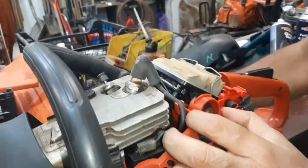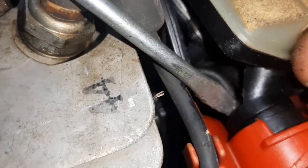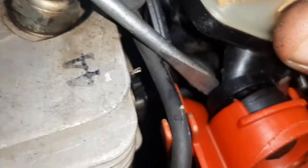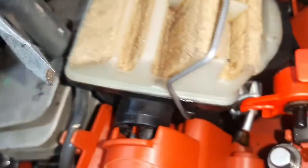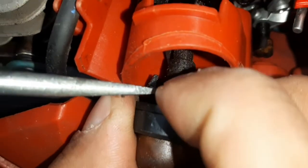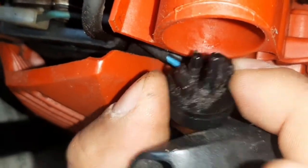As you can see, the whole carburetor and intake is flexing, so you can push it aside and see the whole thing. I'm pointing with a flat screwdriver at the upper front tab of the purge bulb assembly — you can push it in and out. The entire purge bulb assembly is just a chunk of plastic with a bulb and two nipples. The upper one is the longer one — remember that.